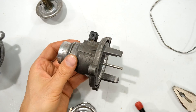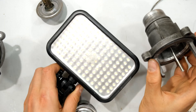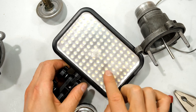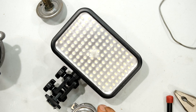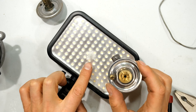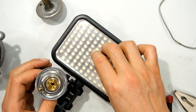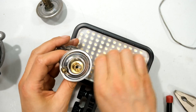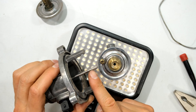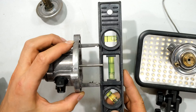I scraped some wax from my older unit and I have some extra wax which I managed to recover. I'm now going to put that into the new unit to reduce the opening temperature, because more wax means more pressure. This is an uncontrolled experiment — I'm doing it by guesswork. I also note that the shaft on the generic thermostat is actually longer than the OEM one: 46 millimeters on the old one versus 48.5 millimeters on the generic.